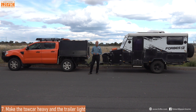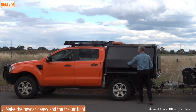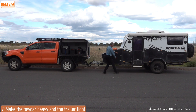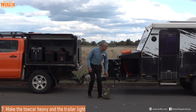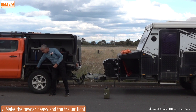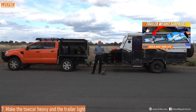The relative weight of tow car to trailer is really important for towing stability. Essentially you want a tow car which is as heavy as possible and a trailer which is as light as possible. That's difficult for the average caravan setup, but every kilogram helps. For example, I have my fridge in the tow car just ahead of the axle, and in the caravan I only carry lighter stuff. I don't carry a jerry can on the caravan because I've got a long-range fuel tank in the ute, and I've got a water tank in the ute as well. All of those things help make my tow car heavier than the trailer, which is really important for towing stability.